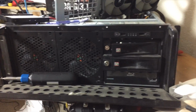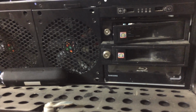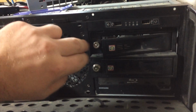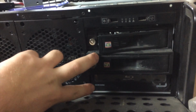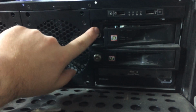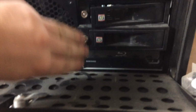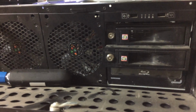Something I've considered doing, though, to accommodate the number of drives that I'm looking to have in a hot swap capacity, is moving the disk drive to an external 5.25 drive enclosure, connect it via USB, and just have it sit on top of the chassis. And then install a device that is 2 bays for 5.25 but has 3 2.5 SSD hot swap bays, and then leave one of these 3.5 in place. So I could have in theory 3 SSDs occupying this space here, and then one of these devices remaining, or reorient that however it'd be appropriate.